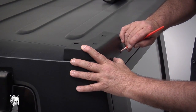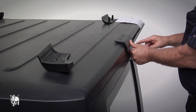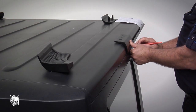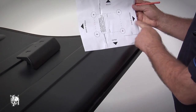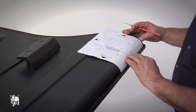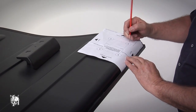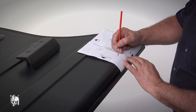It is very important to be accurate when marking. Align the center brackets against the rain gutter of the hardtop. With the center bracket aligned, spot mark the bracket's position. Place the front bracket template onto the hardtop. Sit the template in the rain gutter and align it with the end of the rain gutter. Finally, spot mark the hardtop using the template, using the marks closest to the gutter.